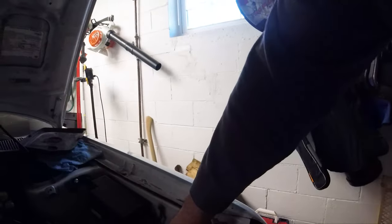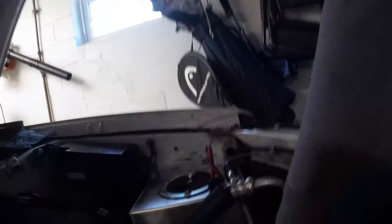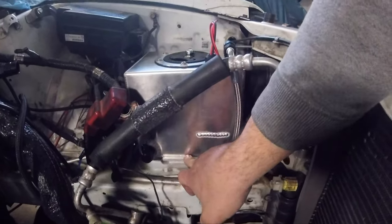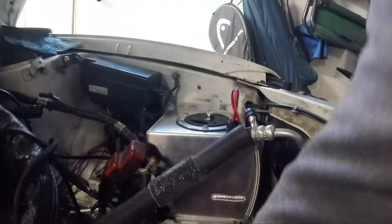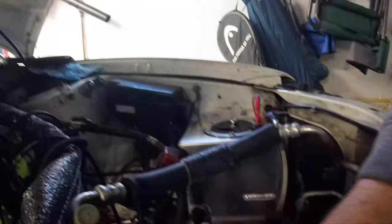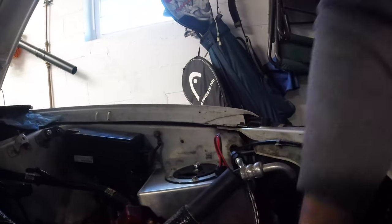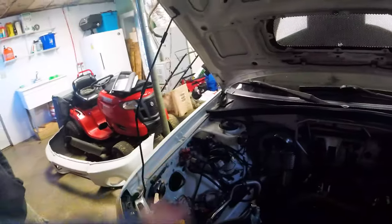So this is going to sit right here, and we'll make a wedge clamp and nut-style hole so it holds down on that bracket. The regulator will sit in the middle, and the AC compressor sits up higher. We're also going to relocate the battery to the trunk — put a bus bar right here and run the cable back before the motor goes in.